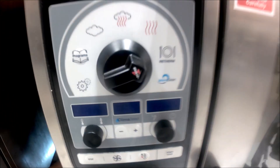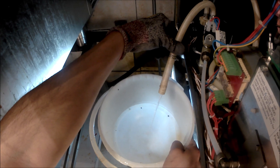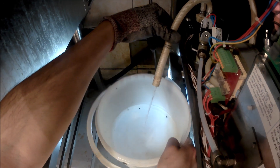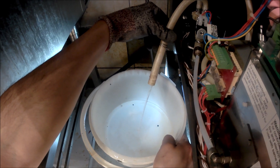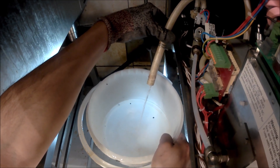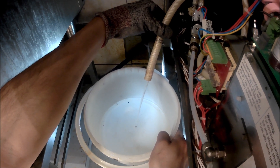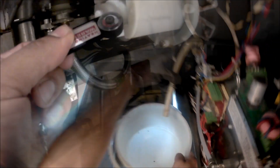We've reassembled. This is how I test the solenoid — this is very important. When you turn on the oven, it calls for quenching for about 10 to 15 seconds. This is how I test how much water we have. That bucket should be filling at least a quarter of the way, if not half of the way. This is the true test to see if that solenoid is working as it should be. In this case, it is not.